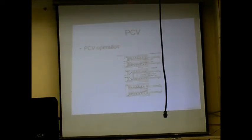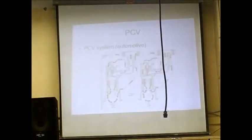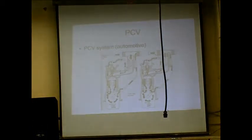That's when you get a problem — you'll notice performance issues at wide-open throttle, and an uneven idle pretty easily. There's the PCV in operation. Usually there's also a source of fresh filtered air going into the crankcase before it reaches the crankcase ventilation valve. You don't want unfiltered air going into your crankcase. Pressure going in helps flush some of these pollutants through the PCV valve back to the intake.